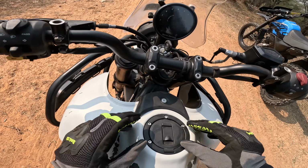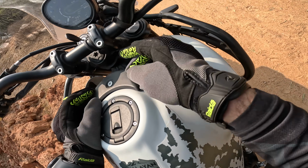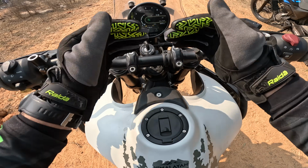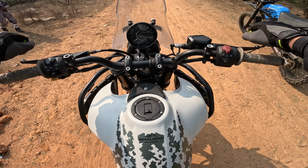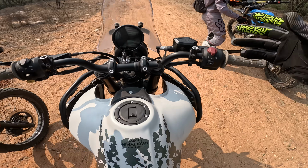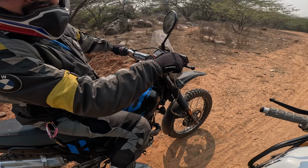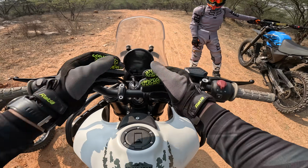Oh, also what we've done is we flipped the handlebar mount. So if you see from here, the handlebar earlier used to sit closer to me. If you flip them, it's going to start sitting slightly further away from you, which opens up the cockpit. I anyway run the handlebar rotated forward so that it's taller and away from the rider. That's the setup that I like. It's 10 to 15 mm forward now from before. So about a centimeter, centimeter and a half. It's moved away from me.